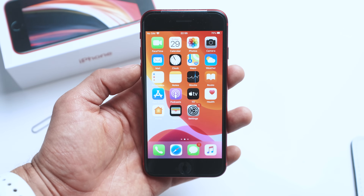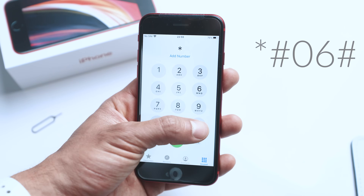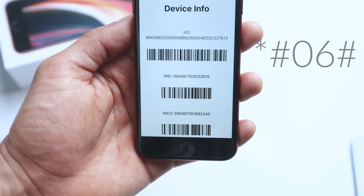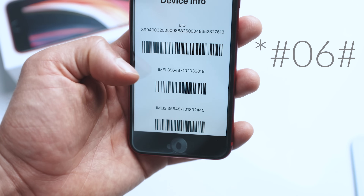Many people do this — it's a very simple process. In case you don't know how, today I'm going to show you. So without further ado, we are going to start with the tutorial. First, you're going to get the phone's IMEI number. To do that, simply go to the dial pad of your iPhone. I'm going to switch cameras so you can see what I'm doing. You'll need to dial *#06#, and your 15-digit IMEI number will show up on the screen. If you can't find this number, you can check the back of the box — it should be written on the sticker there.